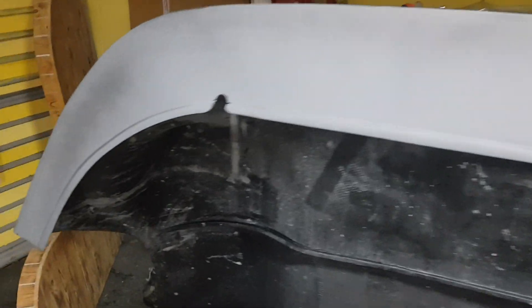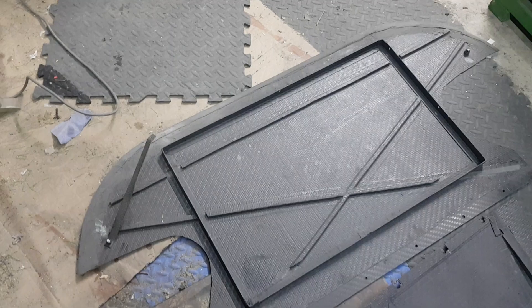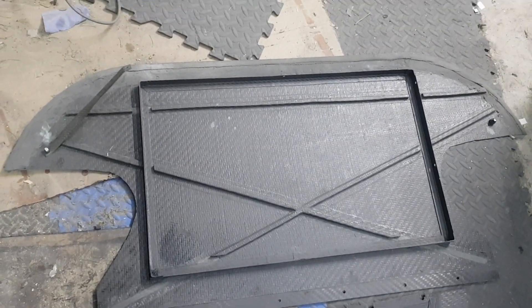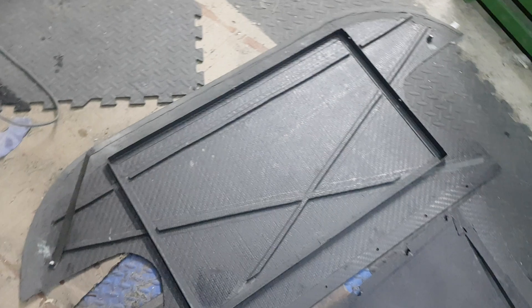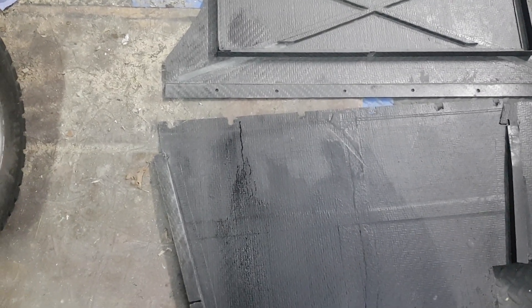The front clam has a splitter, obviously. The splitter's got a slight up-stand or down-stand on the car, which under here is where the first section slips. So the air flows seamlessly over or under the splitter onto this panel here. It's shaped around the wheels as close as possible. The centre box is to catch any leaking fluids so we don't make a mess of the strip at the SantaPod. That hooks onto the crossmember and this panel slips above it, so again the air flows over rather than between them.